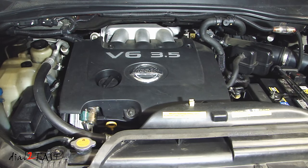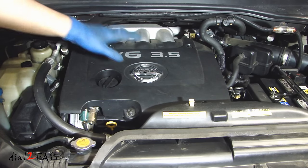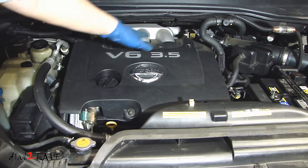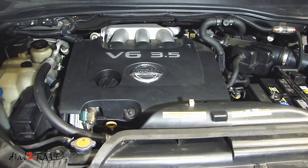A couple years ago I did another series of videos on changing out the valve cover and also the spark plugs on this vehicle, and it was a lot of work. I'm not going to show you all the steps here in detail because you can look at that series. The job is going to involve taking out the window cowl to give me more room to access the back bolts, and then removing the intake plenum to get to the three coil packs at the back. This vehicle is 13 years old with 136,000 miles, so I believe it's one of the coil packs on cylinder 3 going bad. I did buy new coil packs to install, so let's get started.